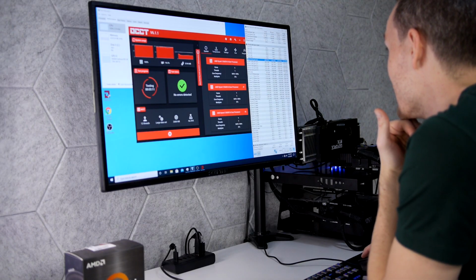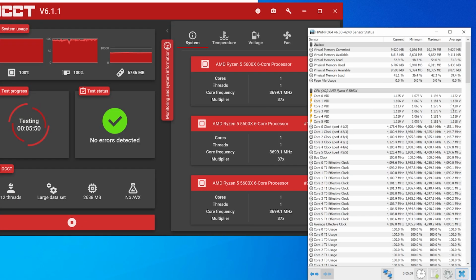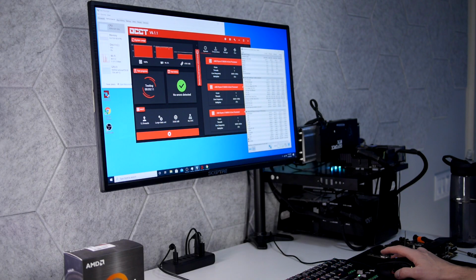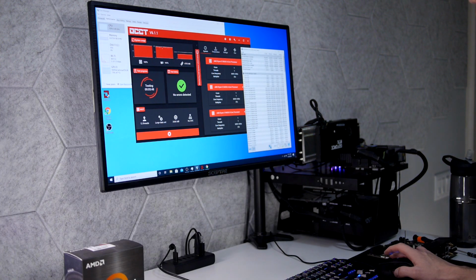Clocks are at 4.1, but we're right up to the thermal limit. Even current, we're 1.5 degrees off. I expected this to be under 4 gigahertz, like maybe 3.8, 3.7. 3.7 is base for this CPU. If you're not running at 3.7 when you're 3 degrees off your max, when are you going to run at 3.7? Is base clock even a thing? Yeah, our minimum has been 3.95 and our maximum temperature has been 97.3. I don't even know what to make of this.